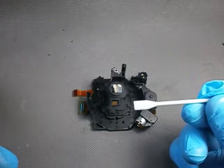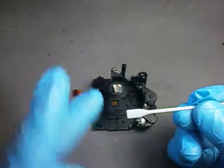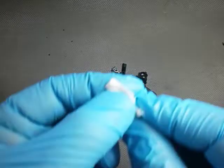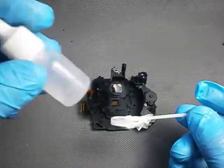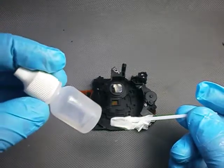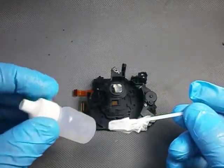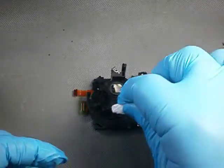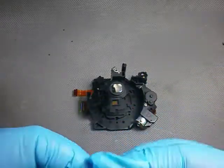For the sensor I had to improvise a swab. I took a plastic coffee stirrer and cut it to the dimensions of the sensor, then took a piece of lintless paper and wrapped it around the tip. This time I used hexane, although I do not recommend it because its vapors are toxic — but that is what I had at hand. I cleaned the sensor window with light strokes from left to right, and with each stroke you have to change the piece of lens cleaning paper.